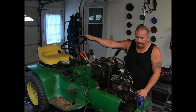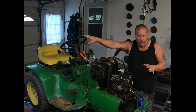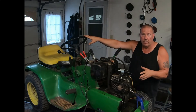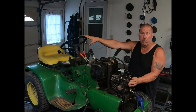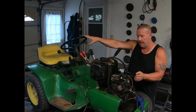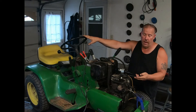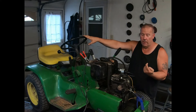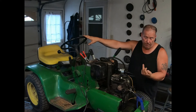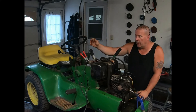So here's where we're at so far. I cleaned the carburetor out somewhat and had it on. I got it to run by cupping my hand over the carburetor, sort of choking it in a sense. It would run, however that tells me it's not getting enough fuel, so the carburetor still needs a little work. It's still got some probably clogged holes in the pickup tube that picks the fuel up out of the bowl — that would be my guess.